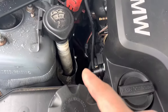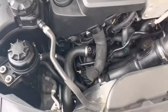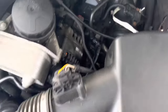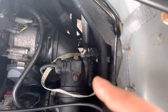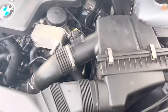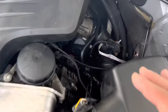On the F30s it should be on the passenger side — it's always near the exhaust or the engine mounts for BMWs. There are other ground wires but those are for electronics. For starting, the main ground wire is on the bottom of the engine. On this X1, and the same for the X3, it was on the engine mount.